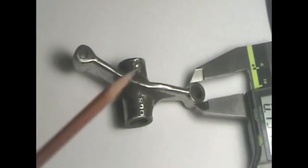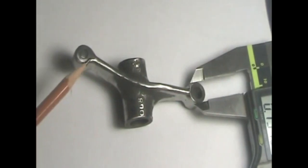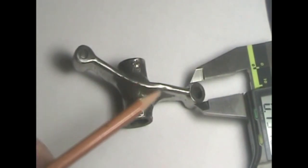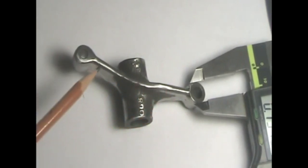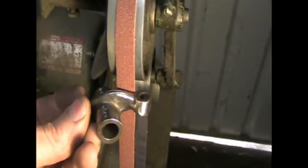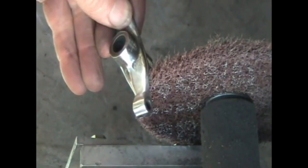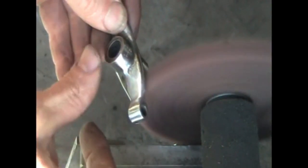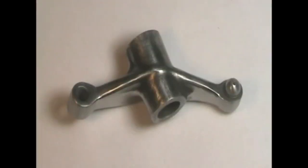Lighten the rockers. Reduce the diameter of the ends to about half inch or 0.450 minimum. Grind off all irregularities and rough spots. Use a thin belt sander to smooth off grinding marks and to get at hard to reach areas. If you want to polish up, use a coarse buffing pad on the finished rocker arm.